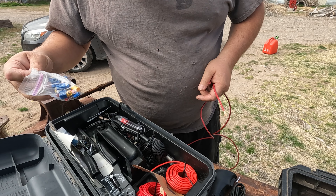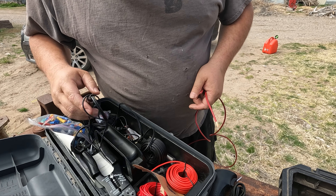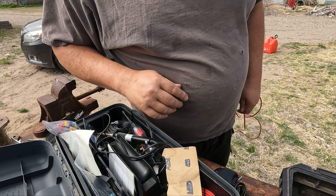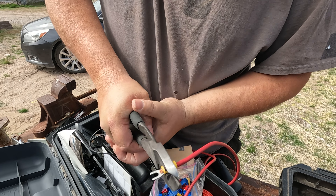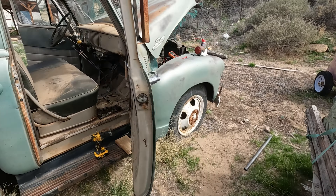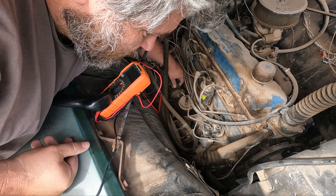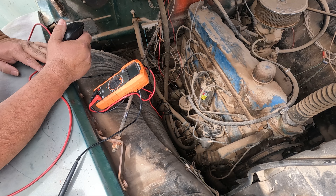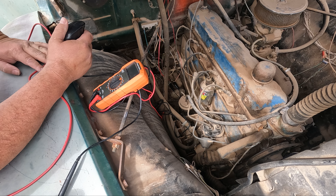I took this 10-gauge wire because it's kind of the right size. Here's the fuel pump from grandpa's — starter switch. It'd be nice to have some alligator clips. No, because I'm not prepared for this. I am a failure today, dude. It's missing everything. I got a couple hose clamps. What if I put one of these on here — what I need is one of these with the little cheater wire connection. I'm seeing what's going on — the starter's got power. Let's see if the engine will turn over. Very important at this point. Let's see if grandpa's battery has enough beans in it.